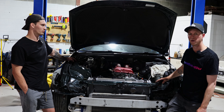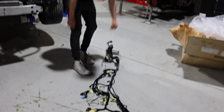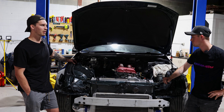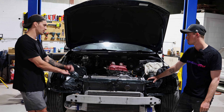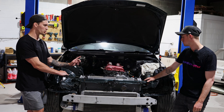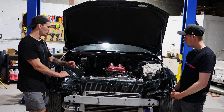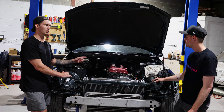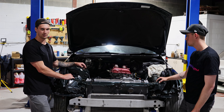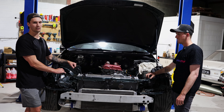Once that's done, everything should run and then it's just a matter of refreshing the gaskets and making everything pretty and operational again. Obviously it's a different turbo, so even if there is a tune on the existing Power FC it's probably not going to run as well — it'll idle fine. We're getting bigger injectors as well, going to pick those up hopefully this week. So it's not too far off, which is odd because this is the first video it's actually been in. Less waiting time for you — more skids more quickly.